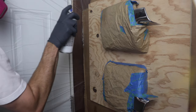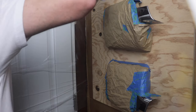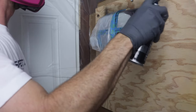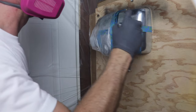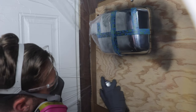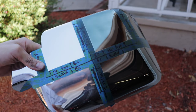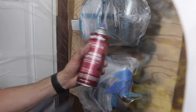The first step after masking is to apply adhesion promoter — just follow the instructions on the can, and within 10 minutes of the last coat I did three coats. Then we put on the base coat, which is Shadow Chrome over the bare metal, the scuffed metal, and the metal treated with adhesion promoter. I ended up doing three coats of Shadow Chrome because that looked best last time — five on the badge was definitely too dark, four would probably be okay. Here's how it looks compared to regular chrome: it is definitely a tinted chrome and there's a noticeable difference.